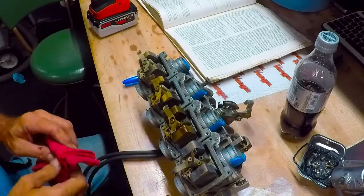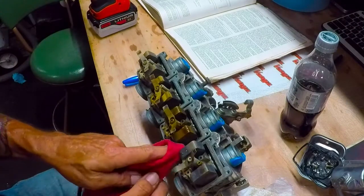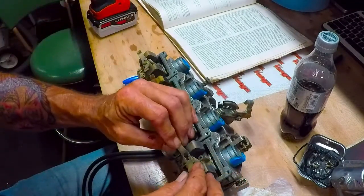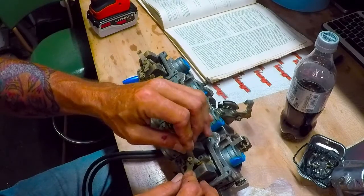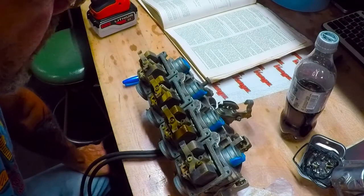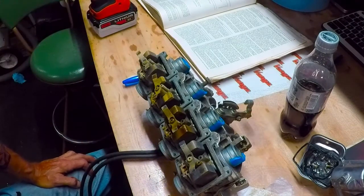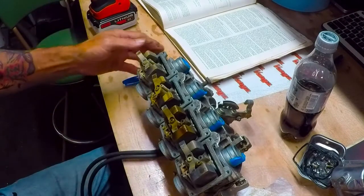I may not even need to go through and rebuild them entirely. It's easy enough to go through them and toss them in the carburetor cleaner. I will remove all of the floats so that I can get to everything — all the needles were stuck. I'm going to go through and just clean everything out as best I can. I don't see any reason to rebuild these carburetors at all. I'm real pleased — I bet I've just got a ton of RTV sealant inside the jets and that's what's keeping things from going.